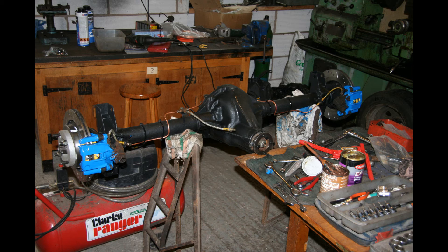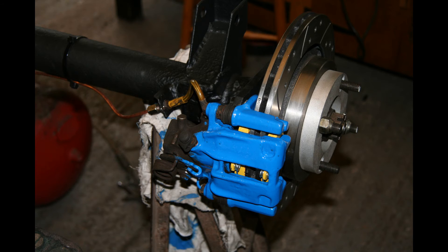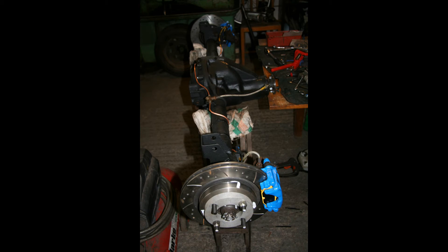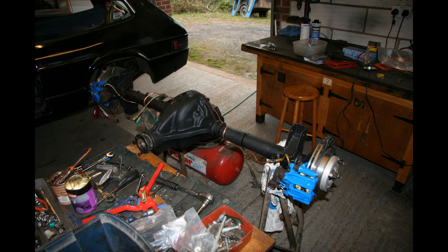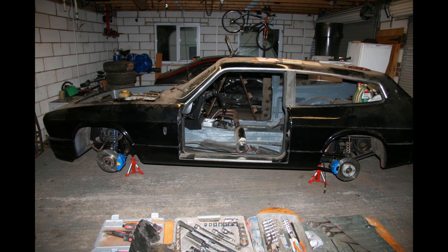So here it is — the final thing. And isn't she sweet? Look at that axle. Now it's a beam axle so obviously it's not ideal, but it is a very strong Jaguar 4HA axle with a Quaife automatic torque bias differential — a fantastic bit of kit — with a very capable set of brakes on either end. The obvious massive Achilles heel of this arrangement is that with the wheels, tyres, brakes and all of it, it has 150kg of unsprung weight, which is 25% of the rear weight of the car. Significant.